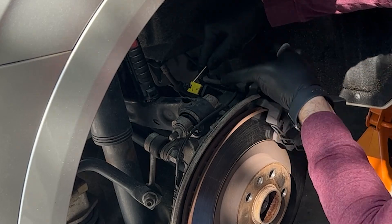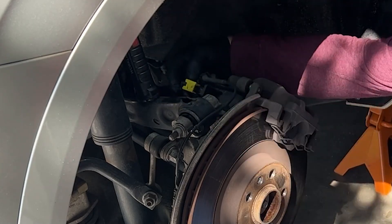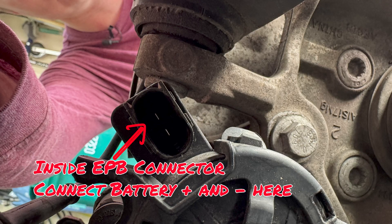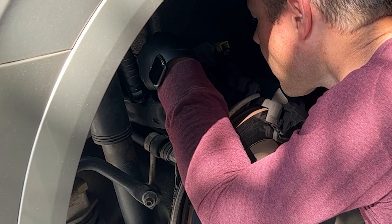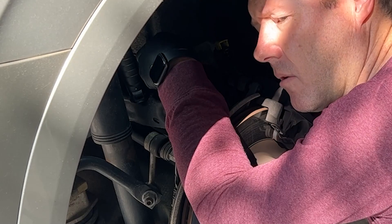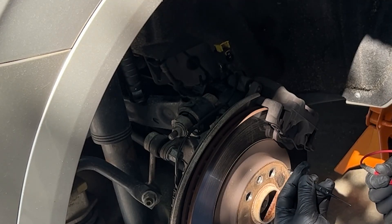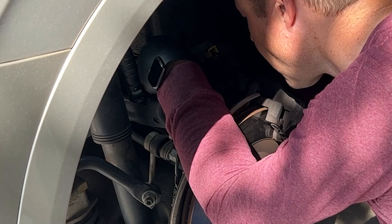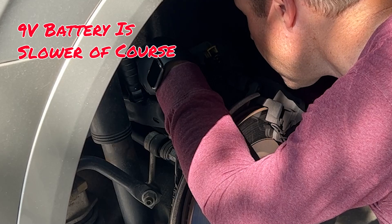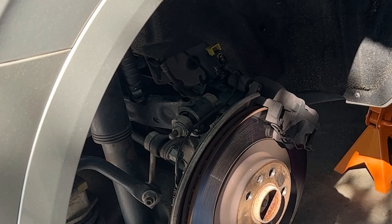I'm lifting up this yellow piece - pretty common for these European connectors to slide out and then slide off. So that's all re-seated. That was negative on top, positive on bottom. Did the seating - now I should be able to reverse it and have it totally release. Of course this would be much faster if it were 12 volts. That motor should be totally released now. Motor works.